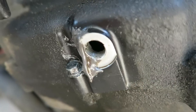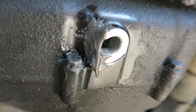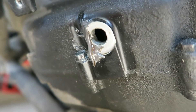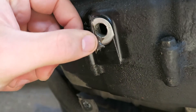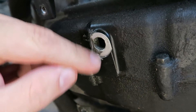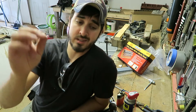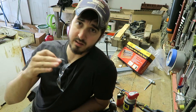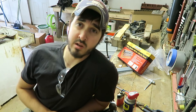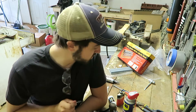Just like that, we're back here again in the motorcycle shop. I'm gonna check the JB Weld and see what it looks like after it's cured. It looks like it had a slight sagging problem. I'm gonna have to trim it up and then maybe reapply some more to smooth it out. I've got a grinding stone in the Dremel — I'm gonna shave away the excess that drooped over and isn't where I want it to be on the aluminum. After that I'll take some sandpaper to put some finishing touches on it, then put on more JB Weld.